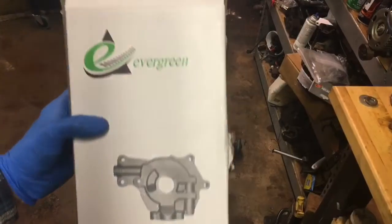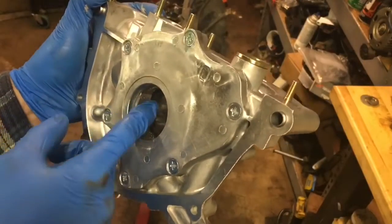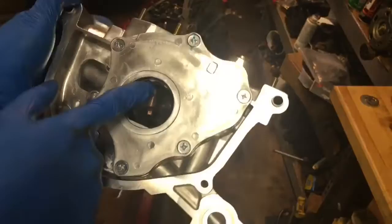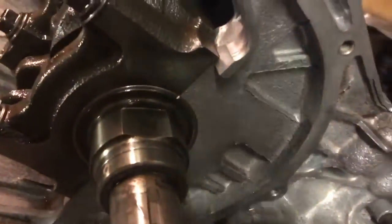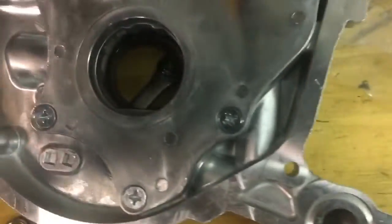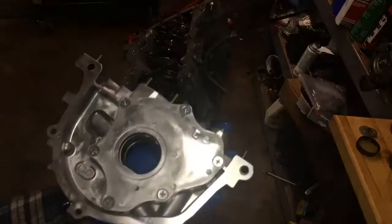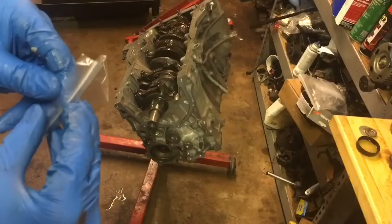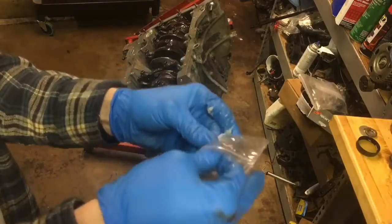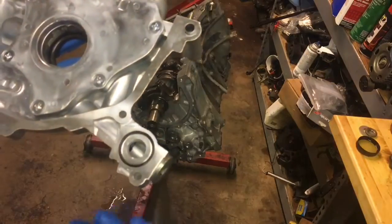I got this Evergreen oil pump from the eBay kit. You see how it has this flat in here — it turns and it's got two notches and a flat. If you look at your crankshaft, notice it's got a flat on both sides. You have to get those lined up or else they won't slide on. Get some oil and put it around. We're also going to put some Honda Bond on here. And don't forget to put your oil pump seal on — don't forget that.